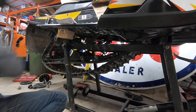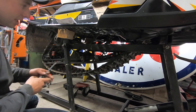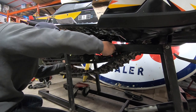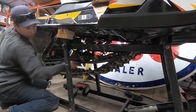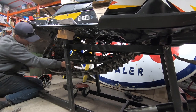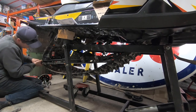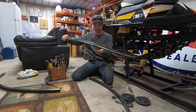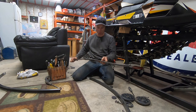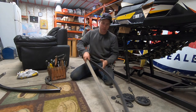With the bolt removed — it's just a small tapered head with a nylock nut on it — take a flathead, get up front in front of your rail, and start working the slider out. Some are going to be easy, some are going to be hard. Once you have your old slider off, you're going to notice it's worn unevenly — that's a Skidoo thing. It always happens like that; I think it's where the snow meets the front of your skid. That uneven wear is normal.